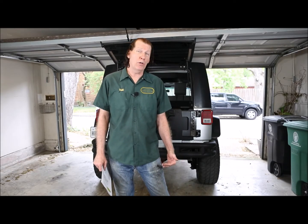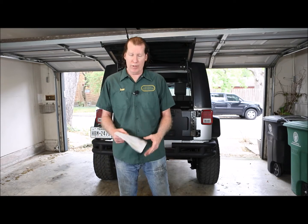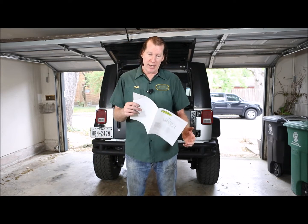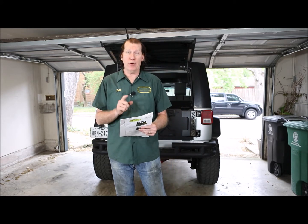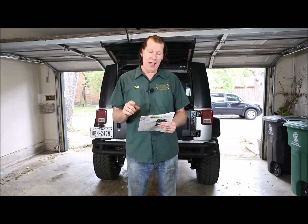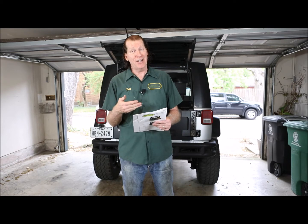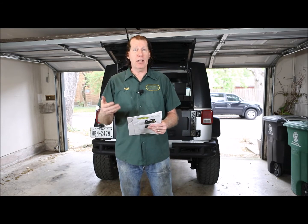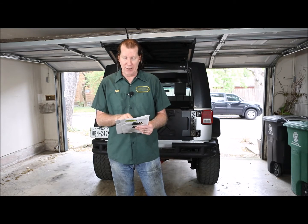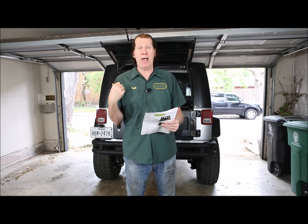The job's done. It took a total of six hours — I did it alone — and it took a little bit of manhandling to get the pins stabbed into the hinges, but overall the assembly and install went smoothly. There are some things in the instruction manual that are a bit out of order. Specifically, there's an inner door liner on the tailgate held by eight bolts, and you need to remove that to slide the hinge mounts inside the door — so one factory-assembled piece has to come off to get the hinges on.